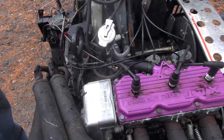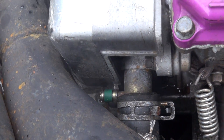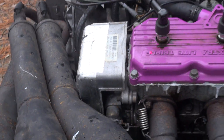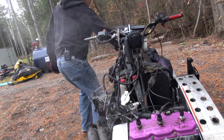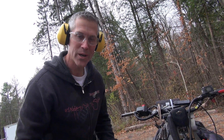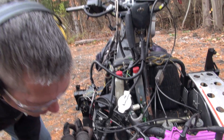We can either put a new hose on. What do we have that we can block that with? We replaced this hose because the coolant going through there is 300 degrees, and the bypass hose — this stuff isn't really rated for that kind of heat. That's the issue we're running into.